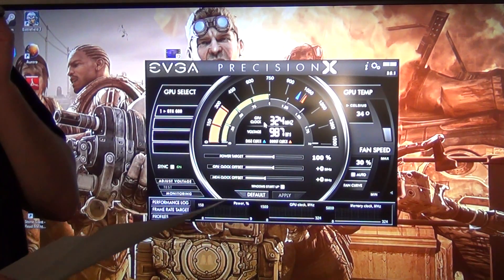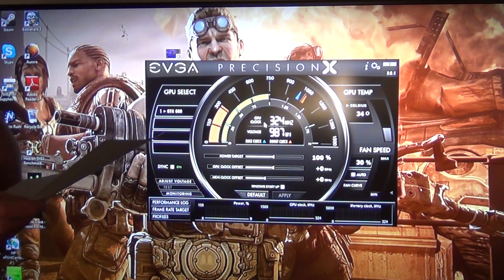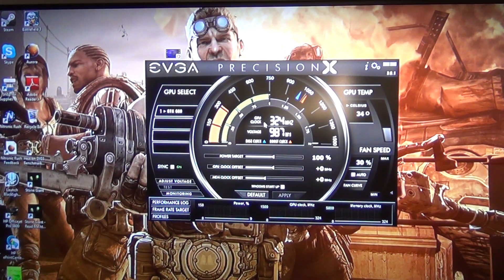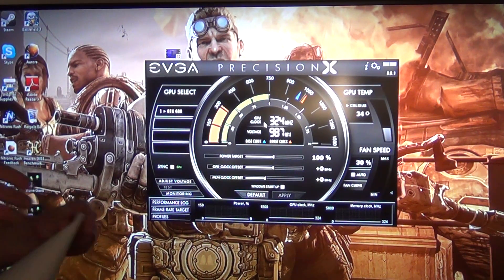When I realized I was not using AA and just wanted to see what I could get — I got 53.3 frames per second average. Score is 1,342. Min frames per second: 21. Max is 135.8. And it was the same settings as my max OC: 1.125 volts, plus 175 on the offset for the GPU clock, and then 515 for memory clock offset.